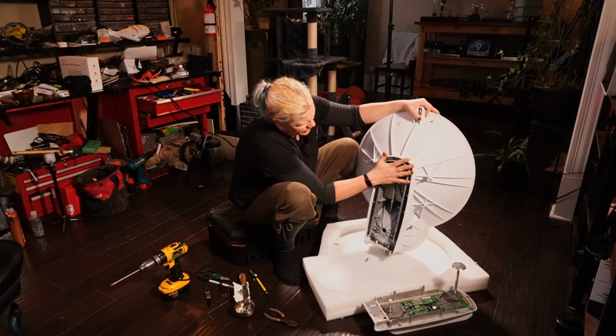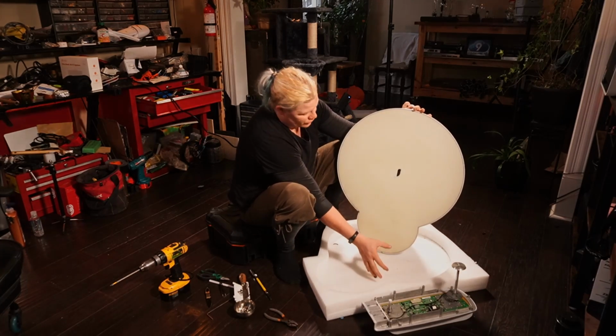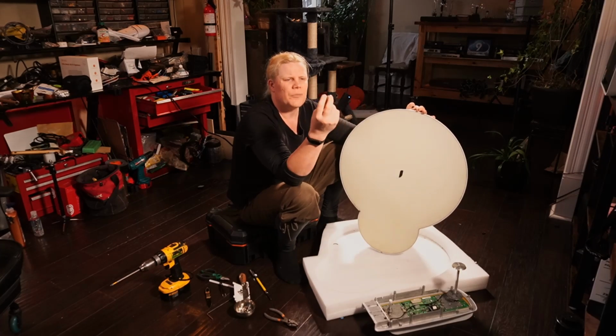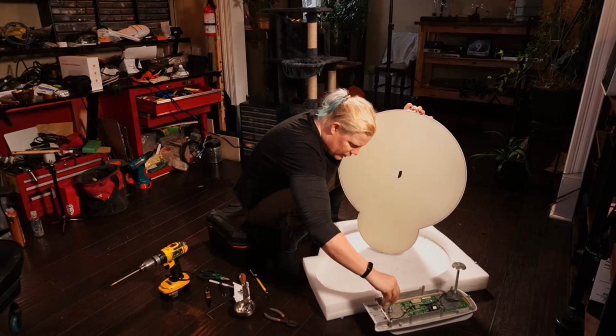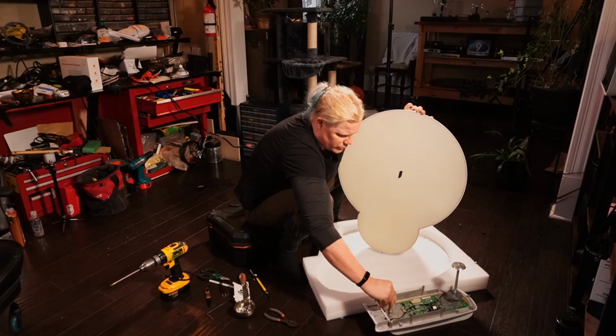Okay. So you've got the receiving antenna and you've got the transmit antenna. The receiving antenna is much bigger because it's collecting all the energy, whereas this one here can actually focus over distance, okay? That's why there's a difference, but look at this guy here. So the epoxy cures and it's no good over time. So with a lot of these guys, when people send them to us, we actually have to glue these back on.